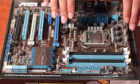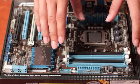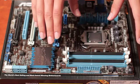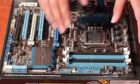And in order to run in dual channel configuration, which means the memory data controller bus will be twice as wide, this also means that you can get more data through in a shorter time frame. This helps aid performance and is quite simple when you consider you just have to buy and install the RAM in the correct configuration to take advantage of it.